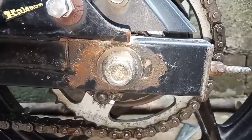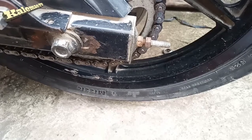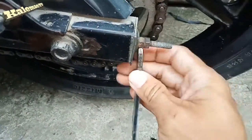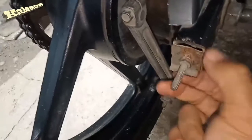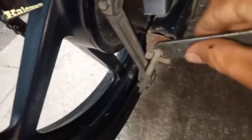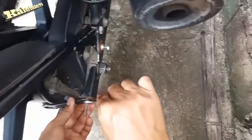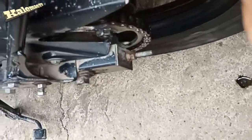After that, don't forget to double-check the marking here — it should be in the same position from left to right. You can see the marking should be the same on both sides. And don't forget guys to lock — you need to tighten the lock nut here like this, outside left and right, you have to lock it. As you notice, there are two nuts here. You have to use a box wrench number 10 like this.